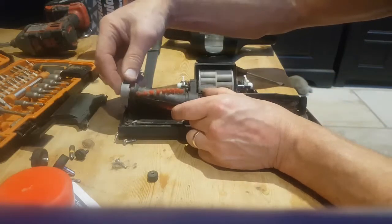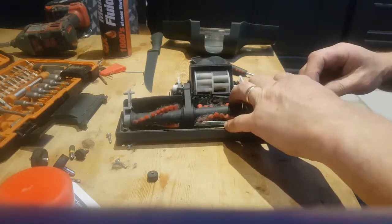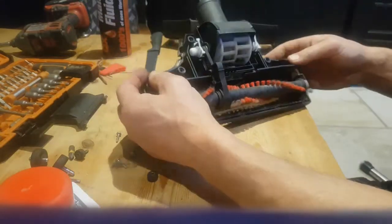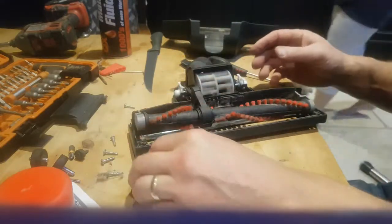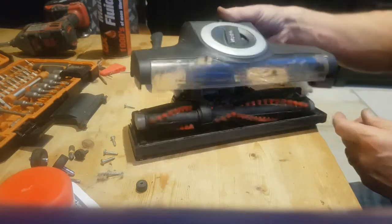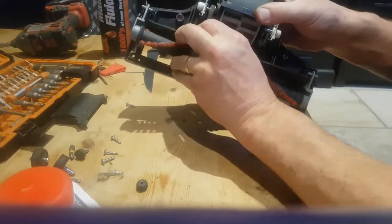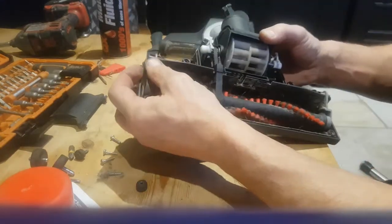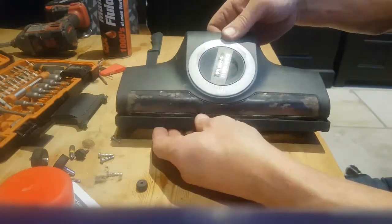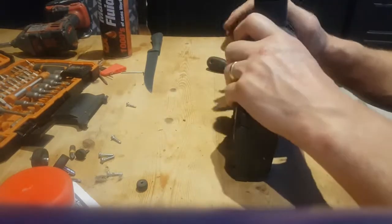Now you want to bed the roller in - just make sure there's no detritus or rubbish in here. Drop them back in and sit them in the guides. Once those two are in there, it's just about ready to go back together. Put this back in, front end first, then drop back. This has two guides and just slides in and clips in. Front end in - give it a little bit of a squeeze, then continue the pressure down the back and it will all clip together quite nicely.